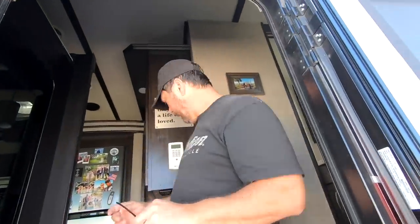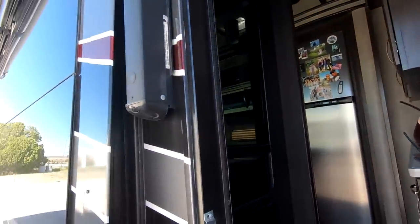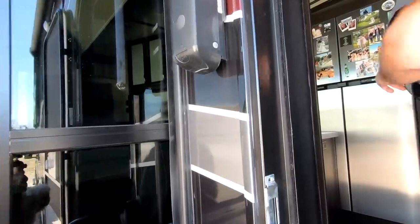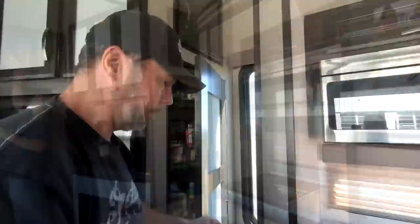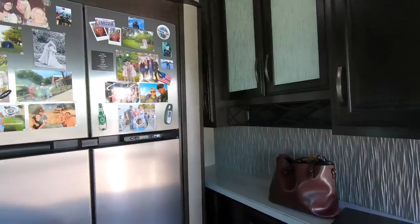It's also come in handy when we arrive somewhere and our pantry door has come open during travel. Instead of what we used to do — climb over the island, which isn't comfortable or easy — now we can just do the one slide and it's easy. So I close the valve for that side because the pantry door opened while we were traveling. Then I operate the slide normally, and since I have that valve closed you can see it's working our main slide first. Then we can come over, solve the problem, open the valve, and put the other one out.